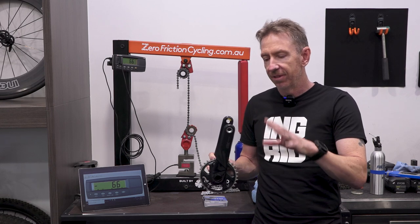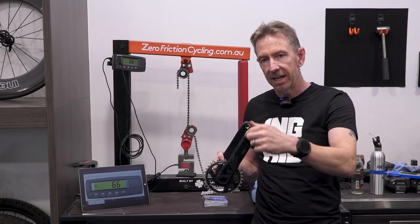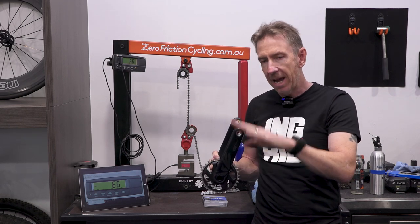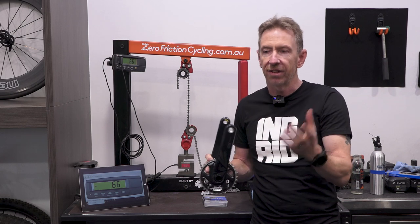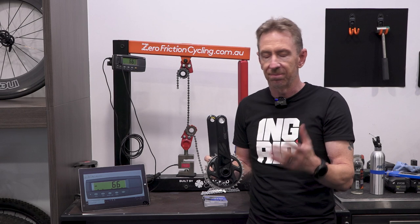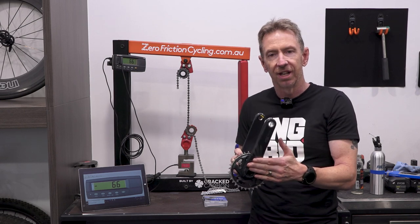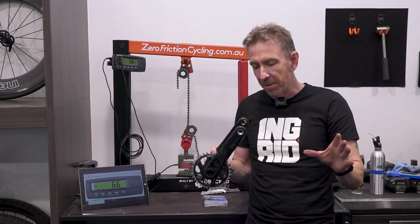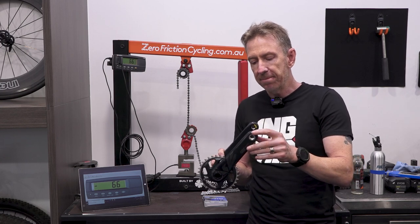And so the power figure is your pedaling force, the force you can put in, multiplied by RPM. For power, they really didn't find a difference between, I think it was about 145 mil crank lengths, and it only started to drop off after, I think, around the 205 mil. So within a pretty extreme range, the power measure stayed about the same.